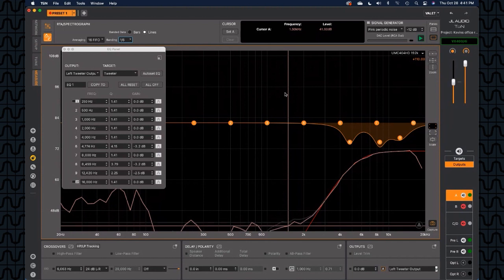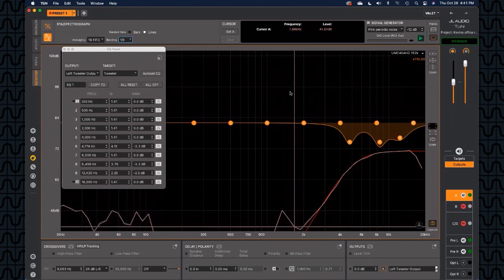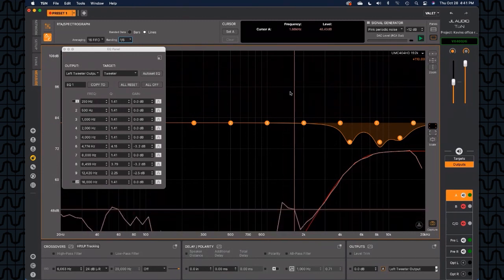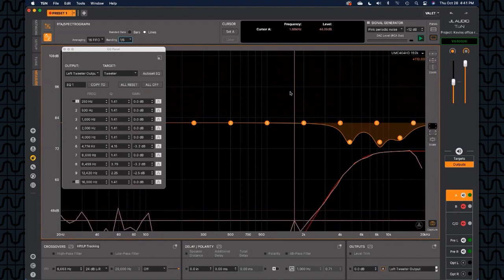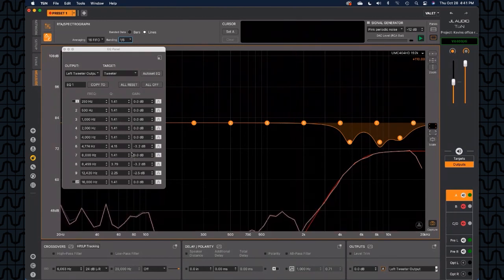Yep. And a couple other things real quick while we're on the auto EQ. As Steve mentioned, with VXI or MVI amplifiers, this will adjust their parametric EQs on board automatically. But if you're using a non-VXI or MVI DSP, in that panel that's popped out, it gives you all of the numbers. It tells you where the center frequency for the band is, the gain for the band, and what the Q is. So if you're working with a PEQ, all you have to do is input those numbers into the individual bands on your DSP, and you should get the same results that the Tune to Target gave you inside of Tune 4. So just write those down, input them in, and you should be good to go when it comes to using the RTA.